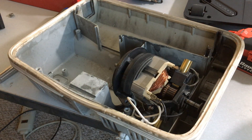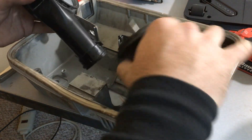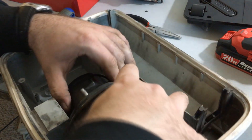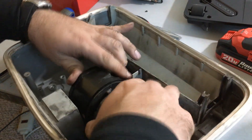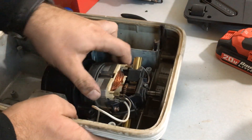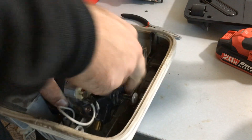We have the new fan chamber. The trick with these is sliding sideways and then pushing them down. Grab your motor and stick the shaft through. You'll need to make sure that you're not going to be pinching any wires, so don't cinch anything down just yet. Make sure everything is accounted for — nothing's pinched, nothing's going to get damaged. A lot of these wires like to hide in spots you can't really see.